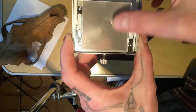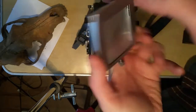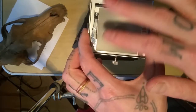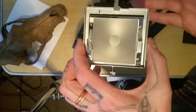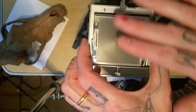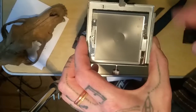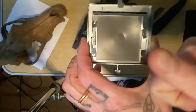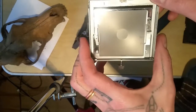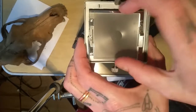That'll give you access to the glass on this side underneath so you can just clean it out. If the light seals don't look super bad and there's just dust or hair or whatever, you could clean it out, give it a wipe, reset the Fresnel on top or the ground glass on top, then screw it back together and you're done.